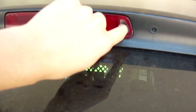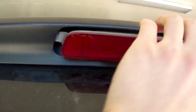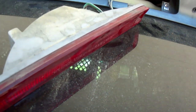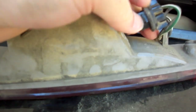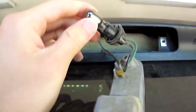So here's a Phillips screw, put it right there again, and then you just pull it out. Now there's a little hook right there. You try to pull it to the right and then pull it out. And here you go. I want to get a hose, well, maybe not, because it's a little dirty in there. But you just twist it to the left or right, whichever one, and pull it out carefully. And once again, I'll list the bulbs in the description. But here you go, you just pull it out right here.